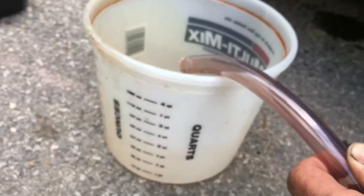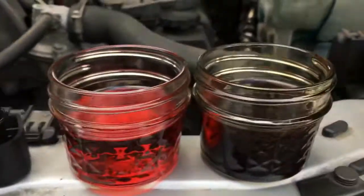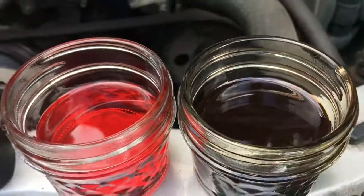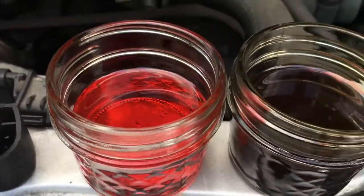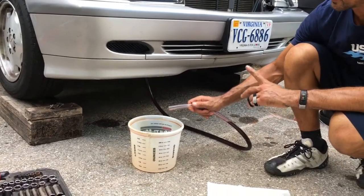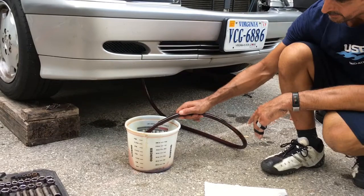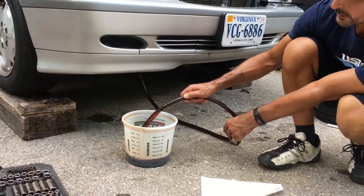My dad's in the car — you basically have him start the engine. You take out two quarts of fluid at a time and then refill two quarts. You want to compare periodically the quality of the fluid coming out with what's going in. On the right is the initial ATF that came out when we first started. This is just to illustrate the velocity that the C230 pumps transmission fluid — you can see it's just flying out of here.